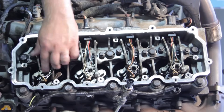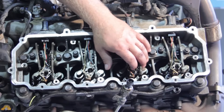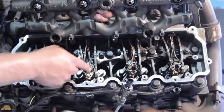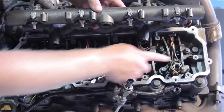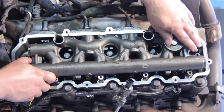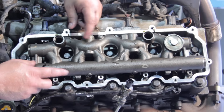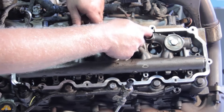Now take a little oil and lubricate the top of the injector — there are a couple of o-rings there that seal against the high-pressure manifold. Make sure that's well lubricated before installing the manifold. The fittings on the manifold set down inside the injectors, so carefully install it, line it up, and work it down until it pops in properly on all four. Never force it and never use the bolts to draw it in — you risk cracking the top of the injector. Once in place, install the hold-down bolts, new dummy plug, and updated two-piece stand pipe.